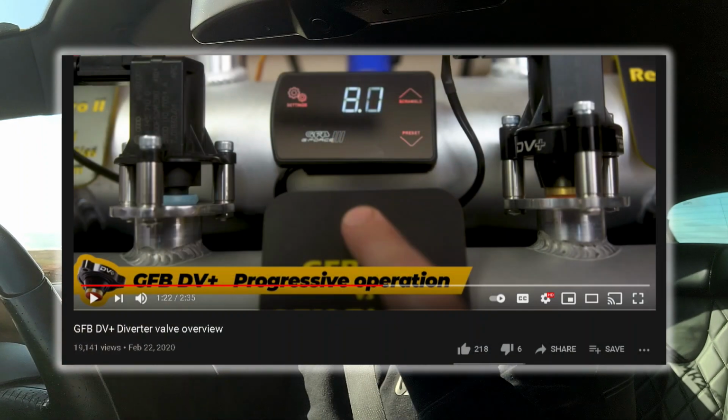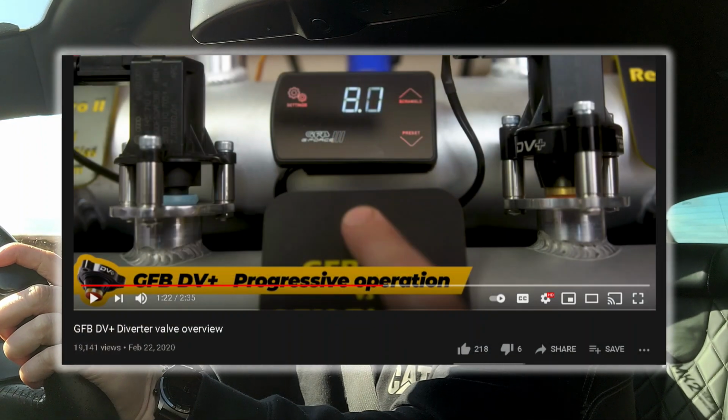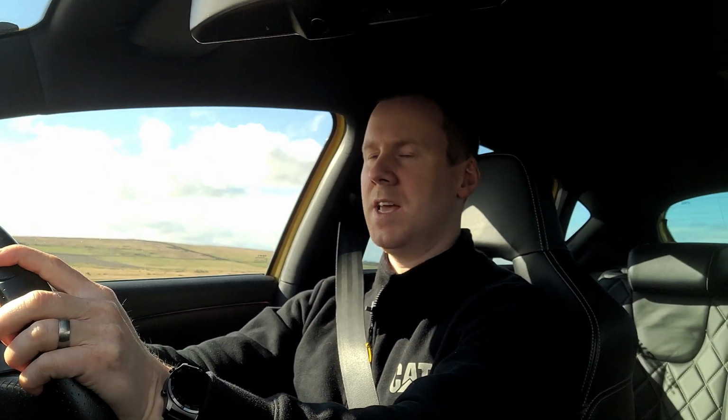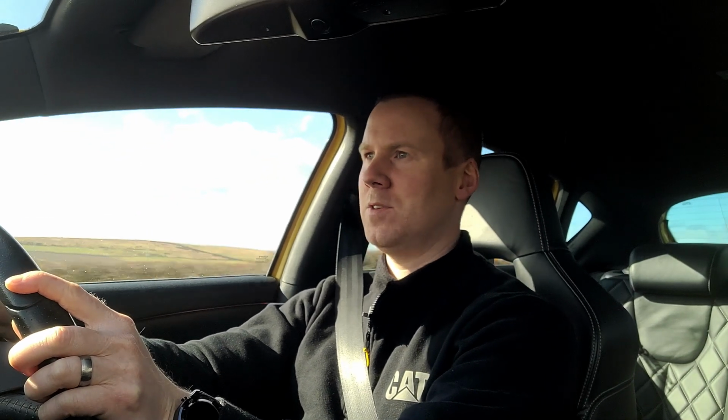Now, I'm not going to go into the reasons of why this is more responsive than the old one. There's a full video on how these things work. I'll put a link below. But the basics of it is this Go Faster Bits diverter valve plus lets through enough air. When you take your foot off the accelerator, it lets enough air get diverted back into the intake and then closes off in preparation for you putting your foot back on the accelerator pedal again. And that's why you get better response. But check out the video below to see how exactly it works. I can't really explain it very well myself.